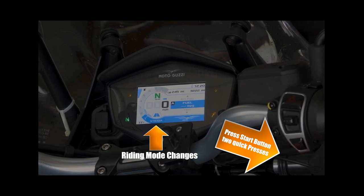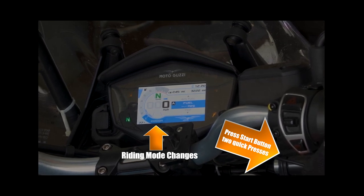There are three riding modes on the 2020 V85: off-road, street, and rain. I believe there's a sport mode on the 2021s, which probably works similarly, but I don't know that for a fact — this is about the 2020. Off-road removes the ABS from the rear tire, and rain reduces the power and limits quick inputs.